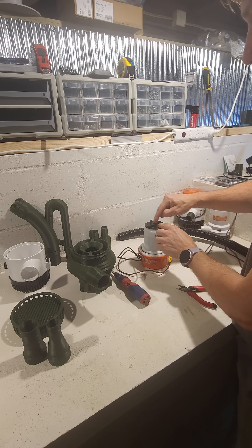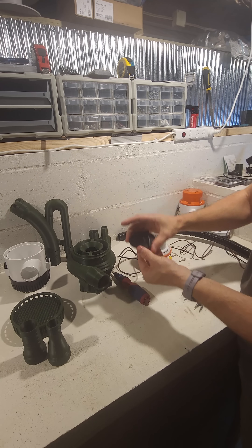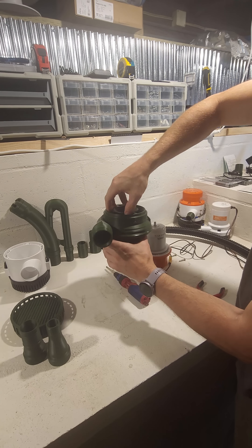Our first step is to remove the six screws so the whole base comes off. With that off we have access to the impeller and a little c-clip. Use needlenose pliers — don't lose it. Remove the old impeller; it has a threaded face.